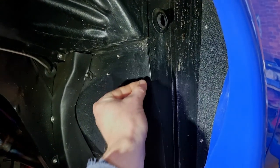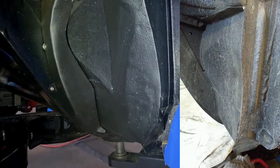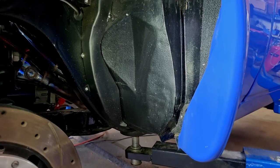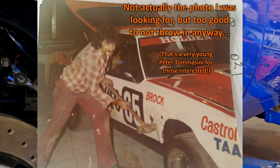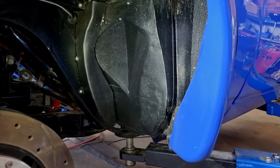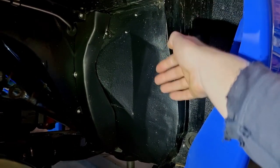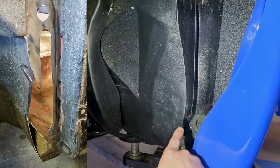The same problem exists even more severely with the body work of the car. It's got a pinch weld kind of seam originally that's very vertical — it goes up and down — and that is totally in the way of decent wide aggressive offset wheels with tires on them. There are photos of people with the Group C race cars back in the day, like Bathurst cars, belting the hell out of that area with sledgehammers. You will need to do more than that in my opinion if you want decent fitment on a flared car. So I just cut that whole area out — that seam, that lip — I basically cut all of it off.